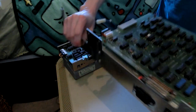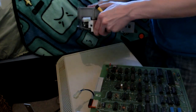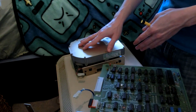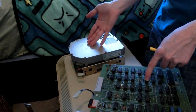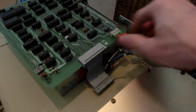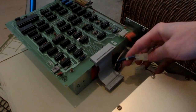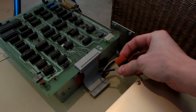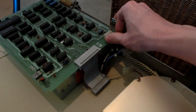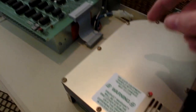There we go — we have the main control unit and we have the Seagate hard drive itself. It's nice that it comes apart into a small modular system, so as long as I get this to work I can always replace the hard drive with another drive from the era. My first concern about why this hard drive isn't turning on is the power supply. Under here we have the main power supply box, and the only cables coming out of it are a Molex connector with five connectors instead of four, and two power cables — maybe 12 volts, maybe 5 volts — going to the Seagate hard drive.